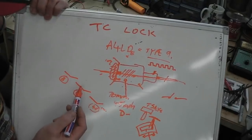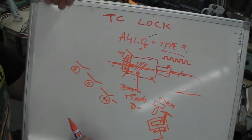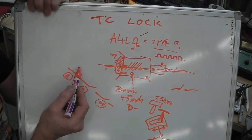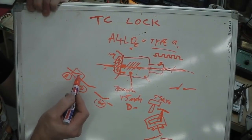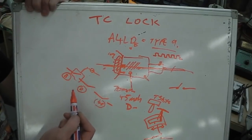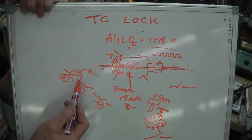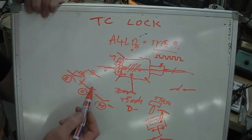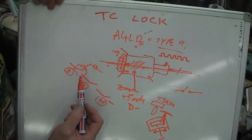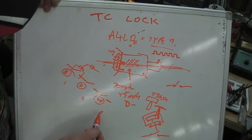To get the brake switch, we don't want to interfere with the car's wiring in terms of interrupting the brake pedal bulb and stuff like that. So what we do, we just get a relay, and the relay will create that contact inside the relay, and the relay then connects to the brake bulb. So you're not interfering with your brake line circuit. So the brake bulb comes on, activates the relay, and then the relay will close the switch. So the relay will isolate us away from the circuit. So that's the brake, dead easy to do. Just get a relay, connect it to the brake 12 volt switch. That'll close, and that'll close our position 1, 2 and 3 conditions.